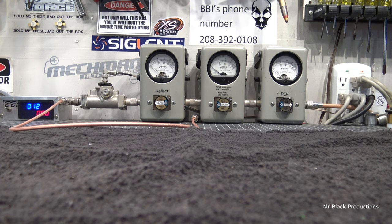And I learned a long time ago that if you have your speaker wire and your coax laying right on top of each other, you're going to get it in your speakers no matter how hard you try to get it out. There's a way to get around it. You'd have to add shielding to a ton of it. It's a lot of work, but usually if you just move the wires apart, you'll end up stopping the interference. But I hope he understands how much better he's actually transmitting now by having his vehicle bonded.